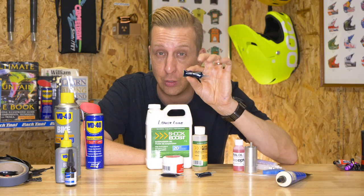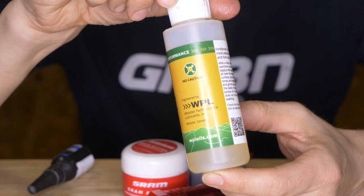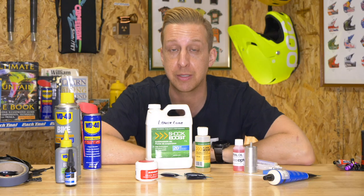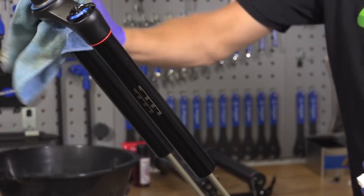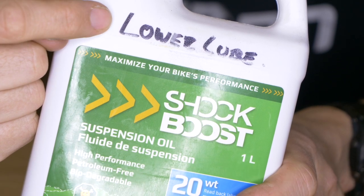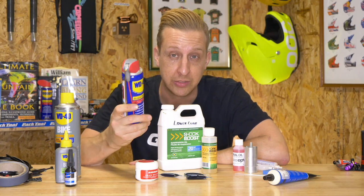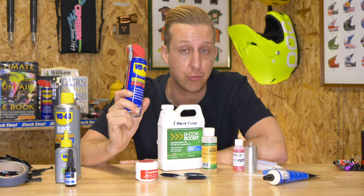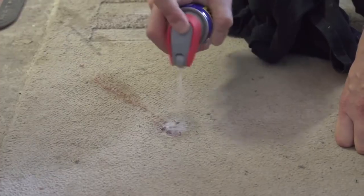Some float fluid is really good — it comes in handy little pouches so you don't waste too much, and it's well worth investing in. There's also generic fork oil, or you can get spray-on silicon oil suitable for using just under the seals for a quick refresh. For the lower legs you'll need a heavy-duty lubricating oil — nothing to do with the damper. This particular one is a 20-weight oil from Whistler Performance Lube, but there's plenty available from Fox and other manufacturers. The very last thing is a water displacer — I always use WD-40. Good for many purposes, you can use it as a lube in extreme cases, but be careful as it's also a solvent that can remove lube and grease from parts of your bike.